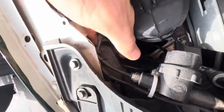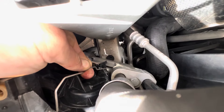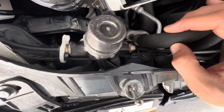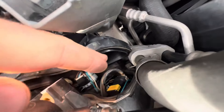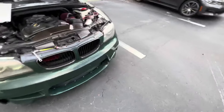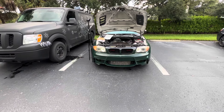I'll start with this side. There is one silver bracket back here so we're going to be popping that off — a little pull, there's one side, there's the other side. After you pop off that cap, be mindful of this oil cooler line right here. I'm pretty much just going to get this bulb out, unclip the plug right here, and then throw in the new one.